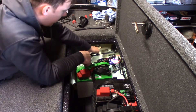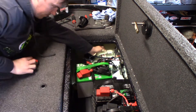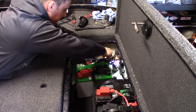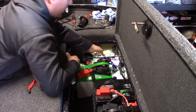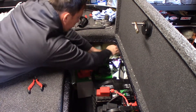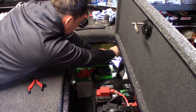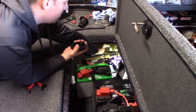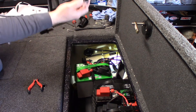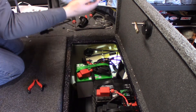Next step: you want to cut the filler cap string off of the actual oil case — I'll probably need a razor blade for that. When you're drilling make sure you vacuum out all the dust; the last thing you want is any fiberglass dust in your oil. You want to remove that filler cap and pull it out. Be careful so your oil tank doesn't tip over and spill. You're still going to use that cap to secure the new fitting into the tank. Wipe out any fiberglass dust that may be in there.